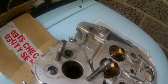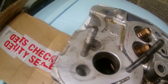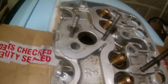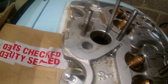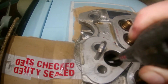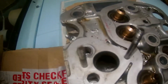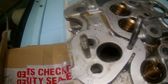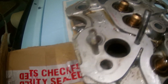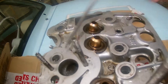It's a little bit difficult to see but you can see there is a bit of a ridge, and we can start removing that ridge and flow this area down here a little bit to make for better airflow. We'll smooth all of this area out — but we don't want to polish it. It's kind of supposed common knowledge that you want mirror-polished inlets, but you really don't, because if you have mirror-polished inlets what tends to happen is the turbulence of the fuel stops and you get droplets forming on the surface. So we'll keep it rough — but not quite that rough, that's just bad casting.